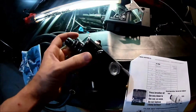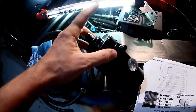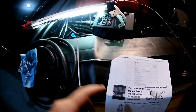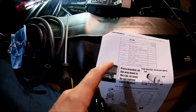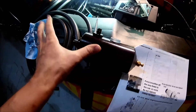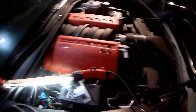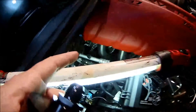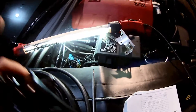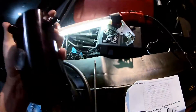But if the pressure gets too great, a little check valve will open up and spew oil if we're on the race track or something, because the worst thing you can do is have pressure build up so much that it starts shooting oil out the top. And of course wherever you mount your catch can, it's always going to be right above some hot exhaust — and oil, super hot metal, fire: bad, right?